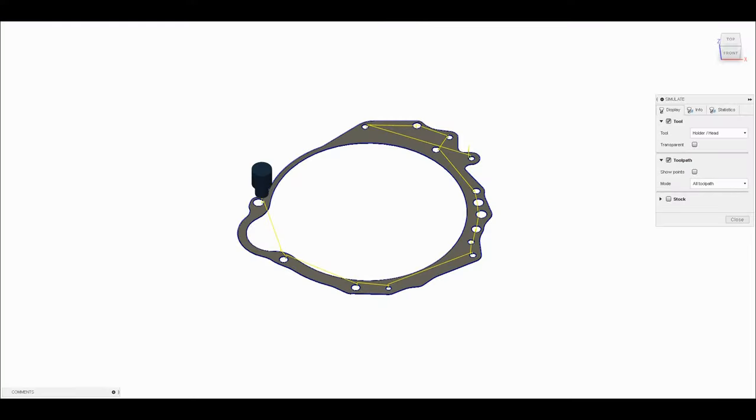With all the holes on the VR6 and the bell housing measured, I drew up a little mock-up plate combining the two bolt patterns, and I'm going to cut that out of sheet metal on my plasma table. I'm just finishing up the program and now we can put it on the table and get it cut out.